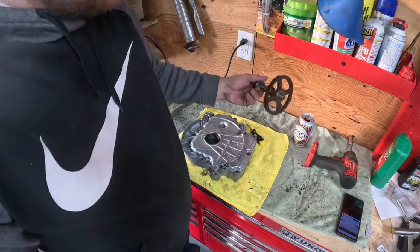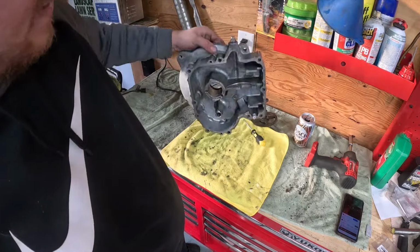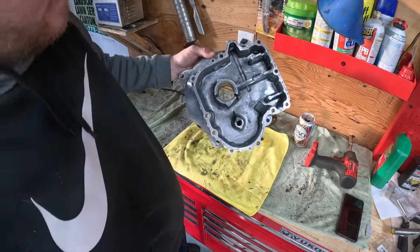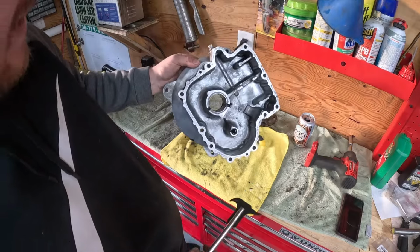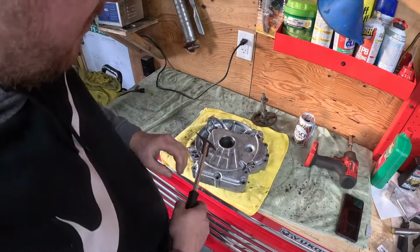Okay, we got our cam nice and cleaned off. Did some ultrasonic cleaning, a little washing. Sump's nice and clean. Yeah, it's a little wet in the inside. We'll let it dry. Just took some engine bright. You see, I got my gasket surface pretty damn clean. Used a flat razor blade. It took a while. Block looks the same way.